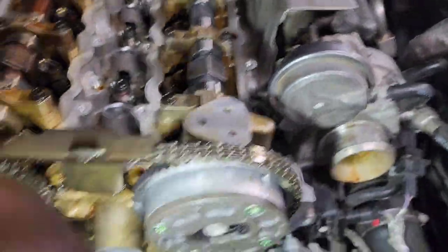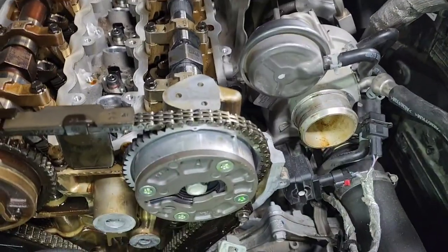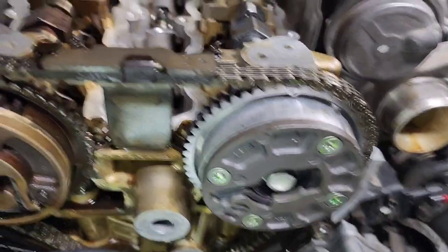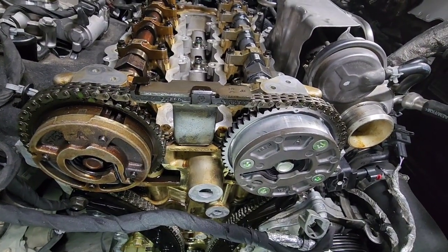I meant to add this. On the car, I ended up changing the cam and the phaser — put the old one in and the car wasn't going to act right. Had to take the timing chain cover back off and put a new cam and new actuator in. I asked all the GM techs at the shop that worked on the 1.5s, and that's what they came up with. Because they gave me the wrong cam and the wrong phaser the first time.